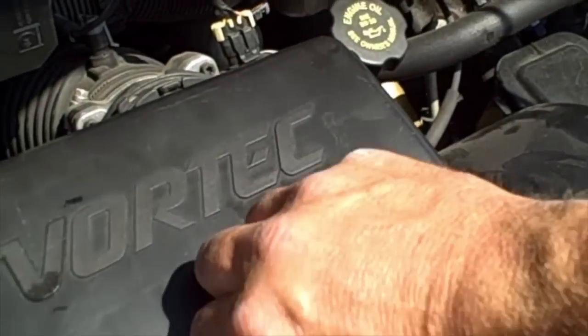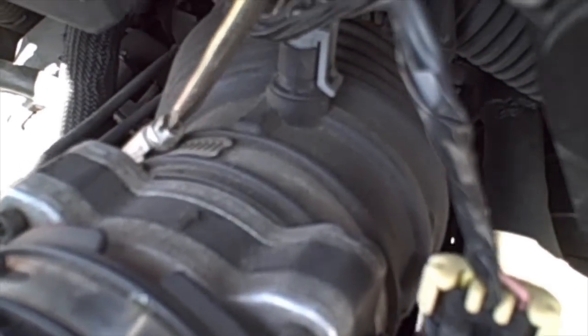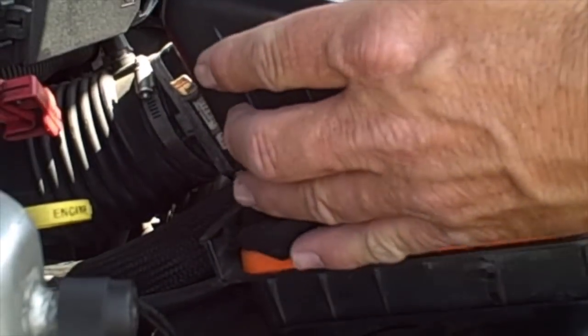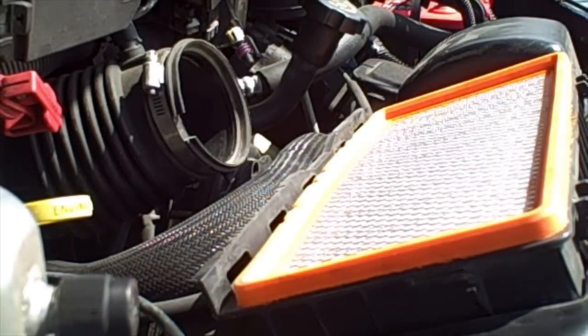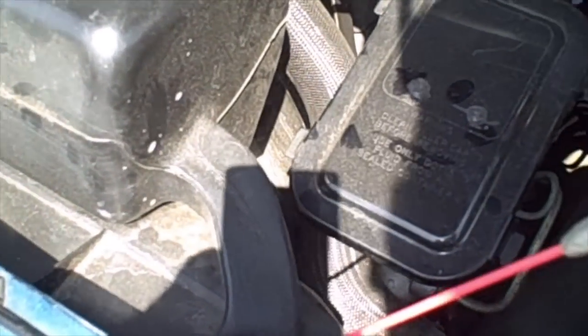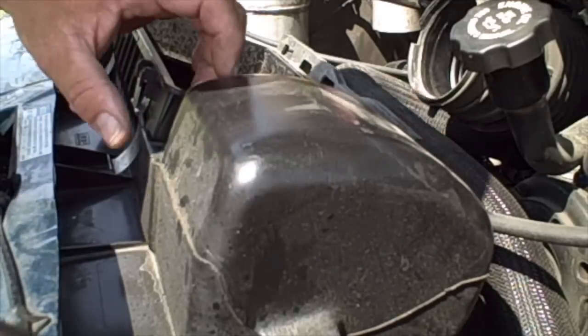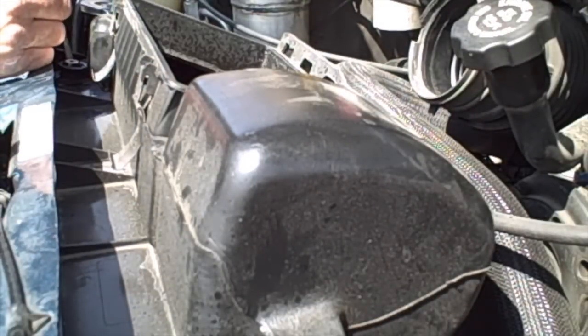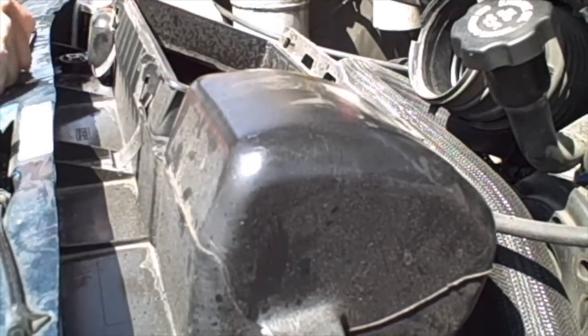Right back here you have a standard screwdriver, so we're just going to undo that and take this case off. We've got some WD-40 — we're just going to spray it around this little rubber grommet, also over here and in here. It just helps so we can pull this piece off. Take a little screwdriver and kind of pry it up. If you don't use that WD-40 you might actually break these tabs or the rubber pieces may break, so it's just easier to spray WD-40 so they pop off freely.